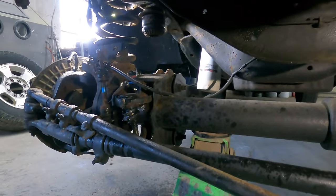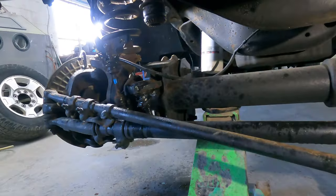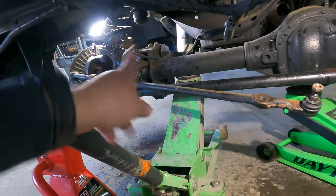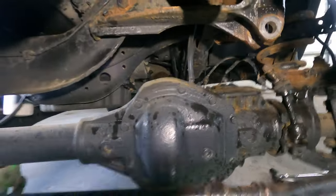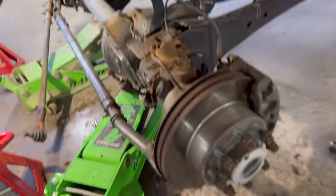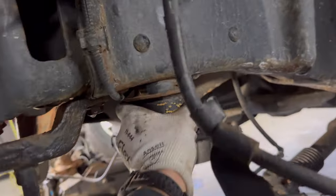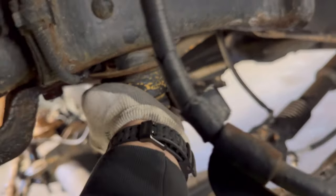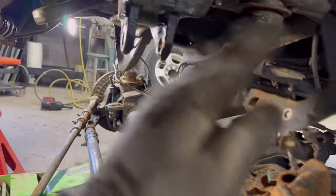Track bar we took out — 30 milli up top, 24 down here for that ball joint. The kit does not come with a new track bar; we bought the Rough Country adjustable track bar and a new ball joint, so we're gonna press that out. Everything is out. We're gonna drop the axle and take coils out. Track bar drop bracket off — three 21s up in there and two 18s. Bump stops we're gonna crank off — they just twist off and there's a bolt in there we'll put the extension on.